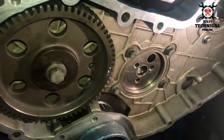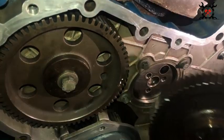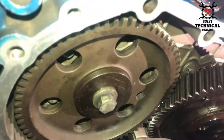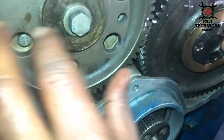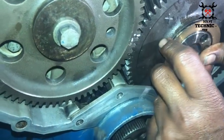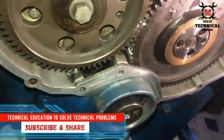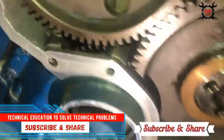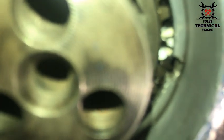As you can see, there are four holes in the body — three holes are for bolts and one is for oil delivery. We have matched the idler gear with the camshaft gear and with the crankshaft gear. There you can see the third dot appearing in between the two dots of the crankshaft gear, which means that the idler gear is at its right place and our engine is timed perfectly.